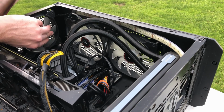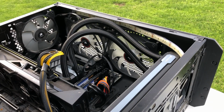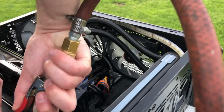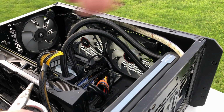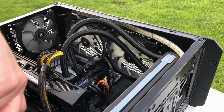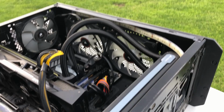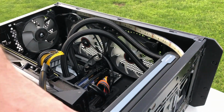And sometimes if it's a really old GPU, if you're into the older stuff, you're going to want to get new thermal pads for the GPU. And sometimes you'll see those on the motherboard on the chipsets. If the thermal pads are not too bad, you can stick them back on there, and usually they'll have enough adhesive to be reapplied.